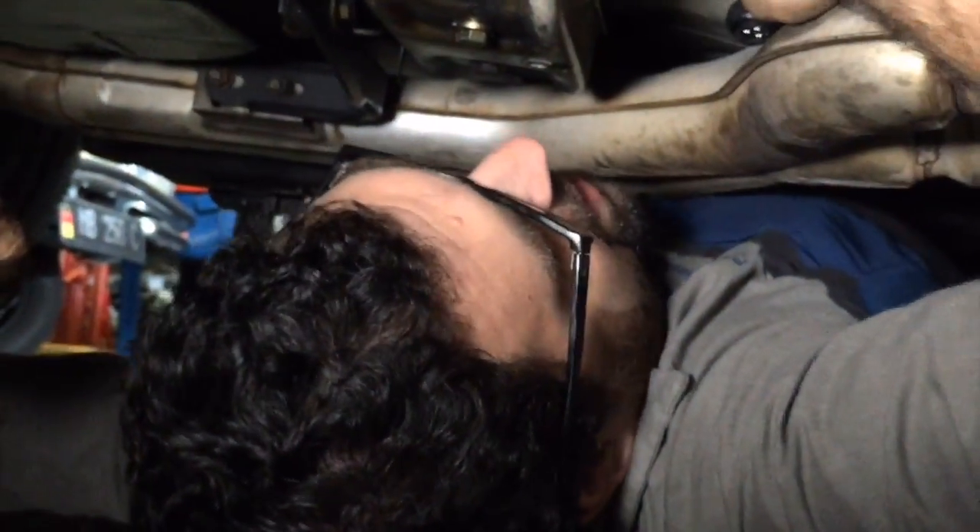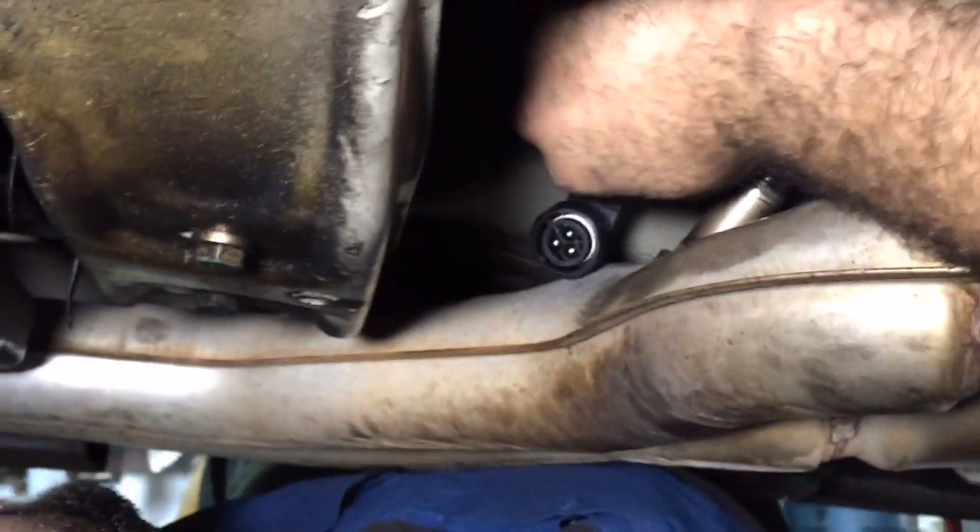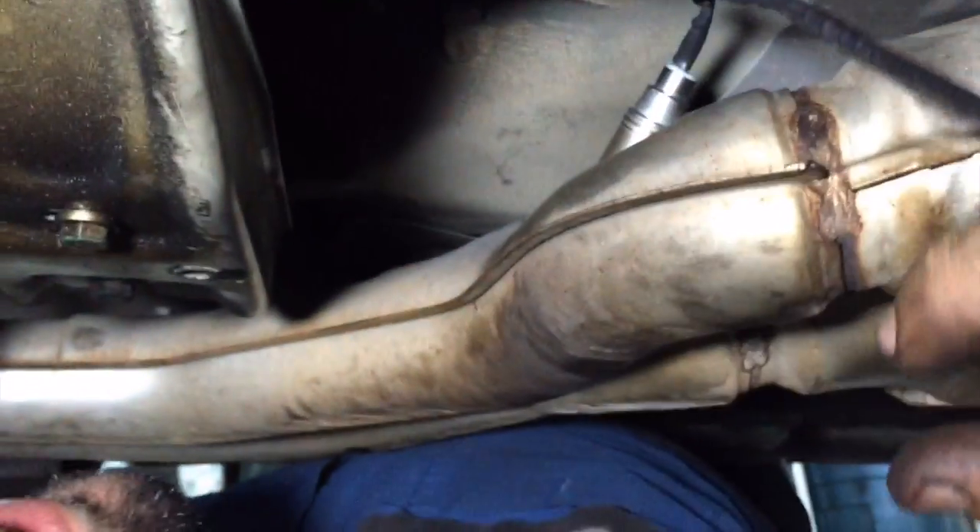Up in here there are brackets that have little plastic retainers that hold the wires from the oxygen sensor onto the transmission tunnel. You should make sure that you put the right clips in those — a typical Mercedes horseshoe clip, white in color, that snaps in place right in that hole.